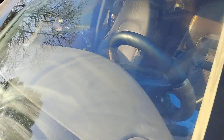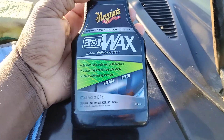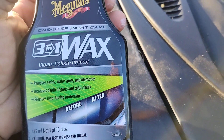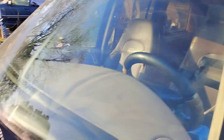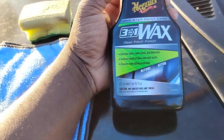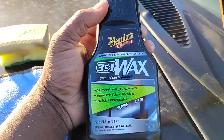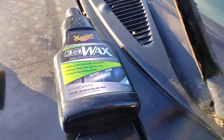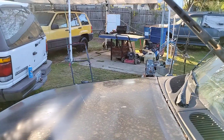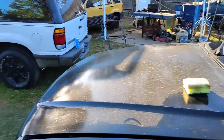Okay guys, I'm gonna take that off. If any sort of water spot or anything was going on up here, this Meguiar's 3-in-1 wax will take them out. Scratch-wise, I don't know — you may want to hit it with some rubbing compound, some Meguiar's M105 or M110 or something. I'm just trying it with the all-in-one, because once you work this in you're also laying down protection at the same time, so your window's gonna stay cleaner for longer.